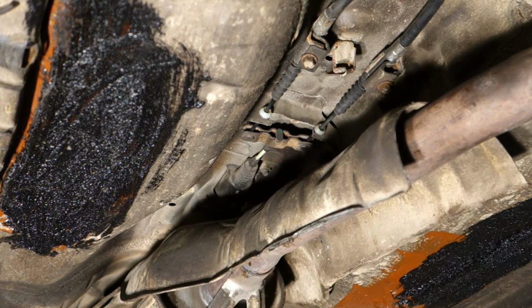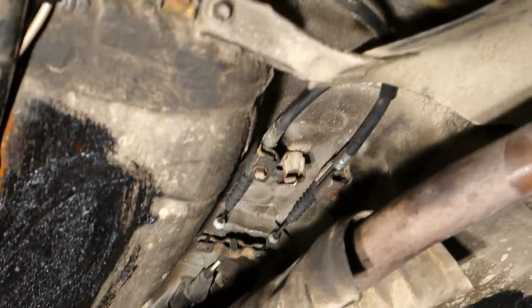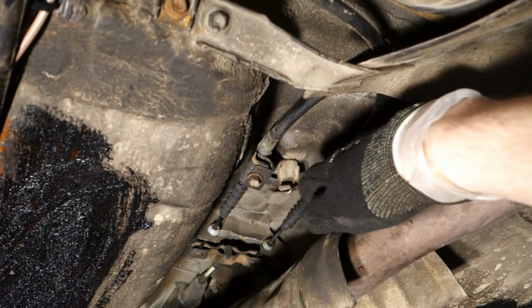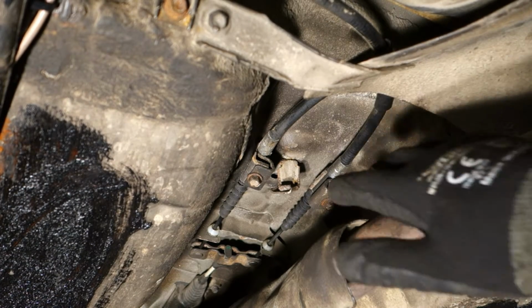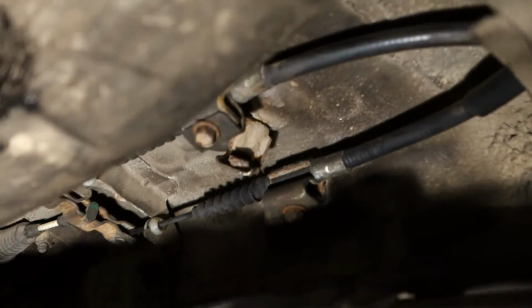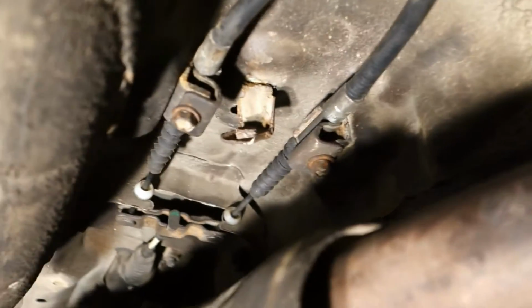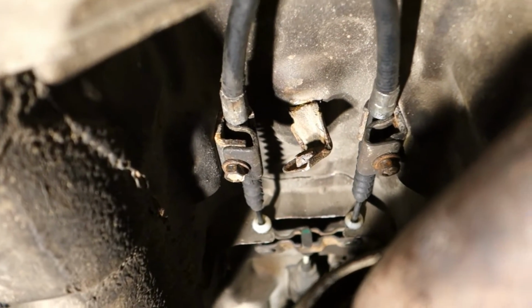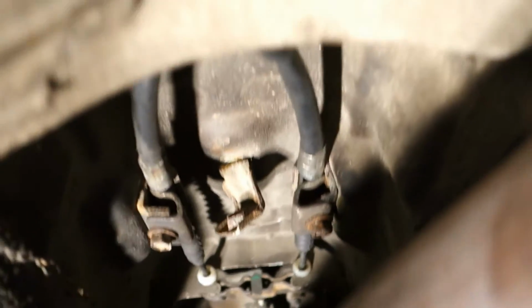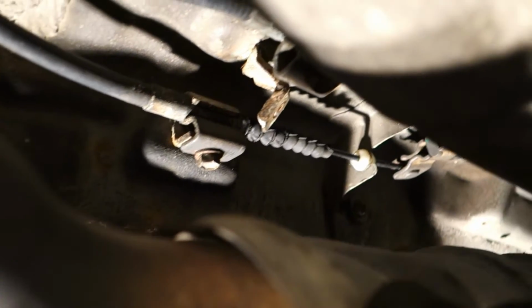And when we are planning to replace these cables, we first need to open the two 10mm bolts, and then remember there is this very interesting Toyota locking system. Now I take a little bit closer view so that we can see how these support plates should be. This is the right way, and then this second one and this one down, because soon we take these plates away, and this is interesting. If you are a little bit too fast, then you have difficulties installing this back.